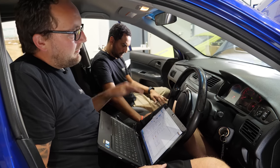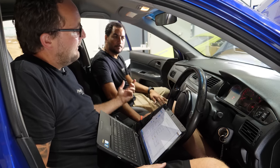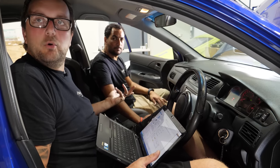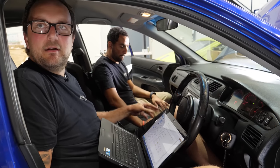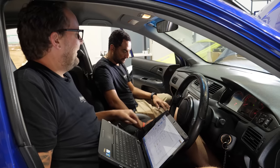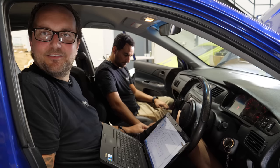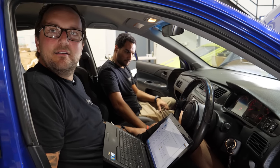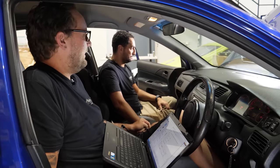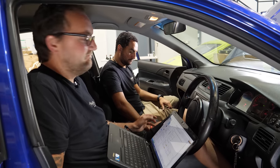So all I'm going to do now is just go through and calibrate anything in the car, like the throttle position sensor, stuff like that. And then I'll go through and make sure all the sensors are actually working. The thermofan is always on at the moment, so I suspect that we just need to make that on when it's off and off when it's on. So out of however many settings there, there's one setting that's wrong. That's done pretty well. Then we'll cross our fingers, try and get the thing to start and run, and then hobble it onto the dyno and try and make the first 100 kilowatts.